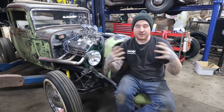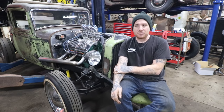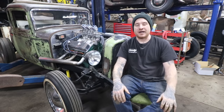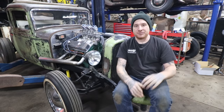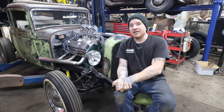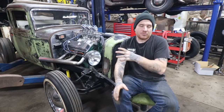Changing valve covers becomes a little more involved and a lot more expensive. So guys would just go to the junkyard, scavenge those parts — or even at that time, you could go to the dealer, order those parts, swap them out, and have a nice little upgrade for your engine when you're just swapping out cams and everything. The 324 engine is pretty much the same. You can identify it by basically the numbers on the block, and there's some other ways you can identify it as well.